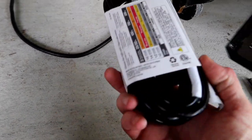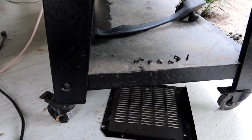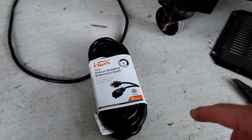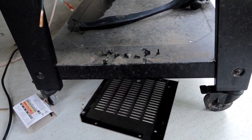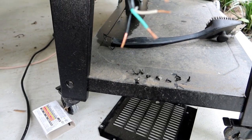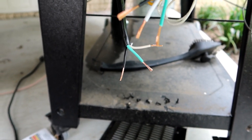I've purchased a standard 15-foot extension cord and I'm going to cut the plug off one end. I've already cut the old cable off and pulled it through the hole. I'm going to hold on to this strain relief piece — this is basically the end where I've cut off. So I'm going to cut the end off of this plug, strip it all back, connect it up to this wire after feeding it through the hole, reattach the strain relief, and we should be good to go. I've got the replacement cable strung through the hole in the back, cut off the half of the plug I don't need, and stripped all of the outer sheath and inner insulation from each of the individual pieces. Now I'm just going to connect these together with a couple of wire nuts and put a couple of cable ties on there to act as strain relief, reattach the strain relief on the cord, and we should be good to go.